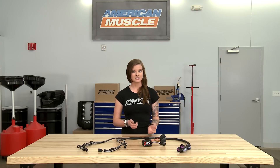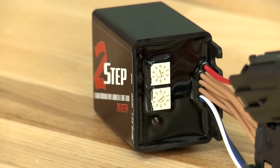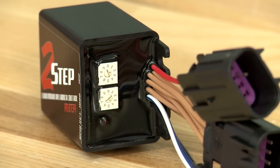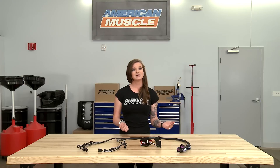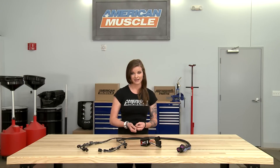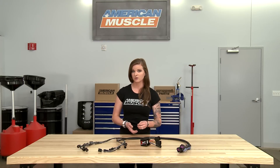The MSD is easy to set launch RPMs. There are two dials where the big RPM range moves in 100 RPM increments, so you can really set your launch RPM where the car performs the best. The other nice thing about this is that it has an LED that will show you when the launch control is active, which is not only helpful on the line, but it's also helpful for the street cars that want to use this.